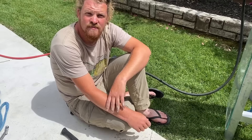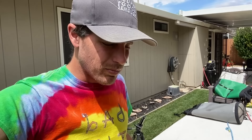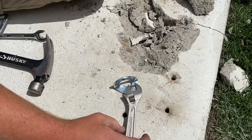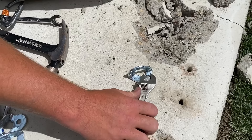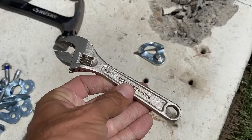No one's really going to carry a torque wrench up a rock or out hiking anywhere. So we're going to use a small wrench — something that we would carry — and see how easy it is to do this. That means you can accidentally over-torque it. But if you just bring a tiny wrench and you pull with muscle, you're not going to accidentally over-torque it to a dangerous level. The concern is that we'd compromise the stud and the threads by cranking it down too much and stressing that metal. We can say that this six-inch or 150mm wrench gets you to about 12 torque ft-lbs — maybe 10 if you're Ryan.